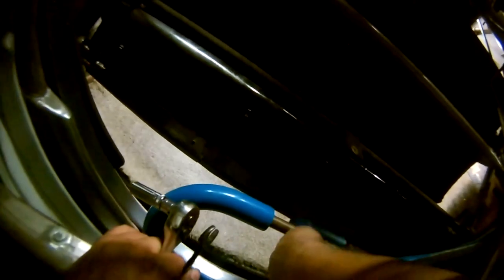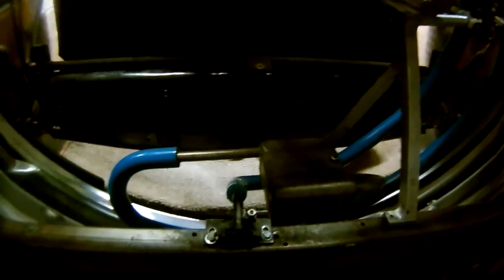Right, now I can still move this around. I want this sitting over the ball wheel, because the ball wheel is where this ball is spinning. Right? So we want this to just rest on top of the ball so that if there is a ball there that's not seating down hard enough to start rolling forward, this will give it a little extra weight. And that's all this is doing. This is not adding any other pressure other than the weight of the rod. So you're talking maybe a pound or two.